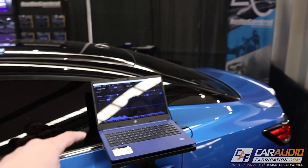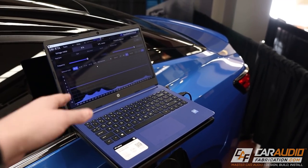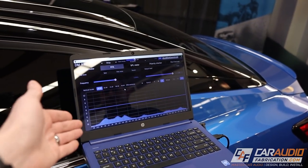A lot of users and enthusiasts kind of miss that point — we need to understand what the signal looks like on the electrical side before and on the acoustic side after. With this being a completely stock system, this is also a great sales tool where you can literally play it and evaluate the performance. You can see exactly what this car sounds like. It's no longer a matter of opinion, because sound is subjective but this is not subjective. This tells you what the car sounds like — you can visualize peaks at, say, 50 and 200 hertz — so you know ahead of time what to expect and what you'll be compensating for when you go to do the installation.